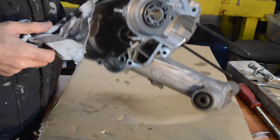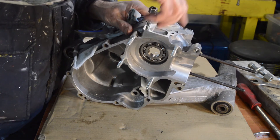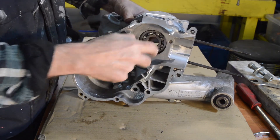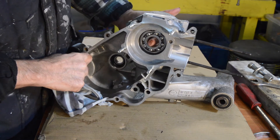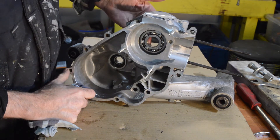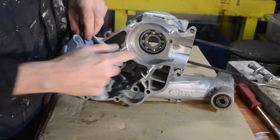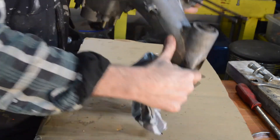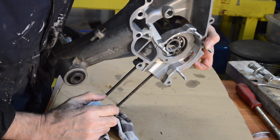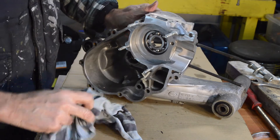A quick look at the cases. The carburetor mounting point area is perfect — the threads for the carburetor mounts are both perfect. All the other screws are good, studs are good, head studs are good. The bearings on this side are SKF — there's no in and out movement whatsoever. I suspect they were changed when the kit was fitted and that's not been on long. The seal faces are all perfect, the inside of the cases are like new. And most importantly, our rotary pad — it's completely unmarked and completely standard.